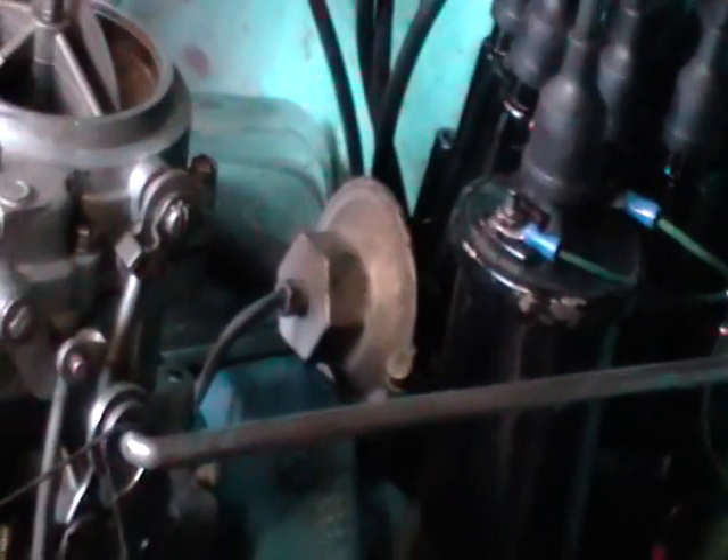Let's see where the timing mark is set right now. It looks like it is below the mark, I do see it in the vicinity. We are going to adjust that by moving the distributor — the vacuum advance — back and forth to bring that line up to the mark. We are supposed to go two marks above zero. Whoever put this distributor in after they rebuilt it must have got it a tooth off, because when we bring it around to make the mark line up, the vacuum advance hits the intake manifold. So we are going to see if we can remedy that problem.